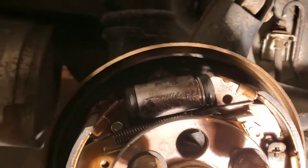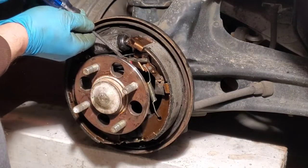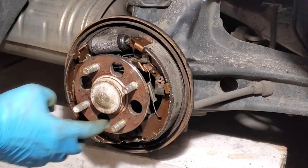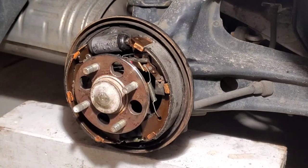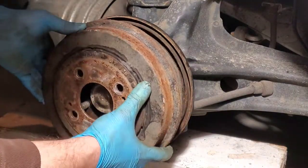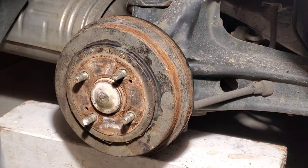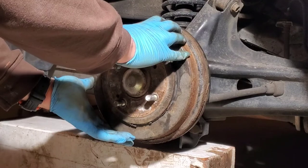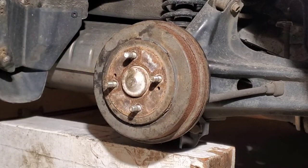What we're going to do is adjust the mechanism here for our e-brake — adjust and expand it a bit. For the front shoe, we have the same three points of contact on both sides, so we're just going to give it a little bit of grease. We're going to throw our drum back on. The drum should just go on — if it doesn't, that means you've extended the adjuster too far out. Our drum is back on. Now we're going to check how tight our shoes are — all you want to do is spin it and you should hear a slight drag. That sounds fine, so we'll get the tire back on and lower the car.